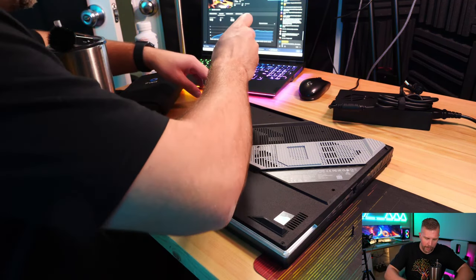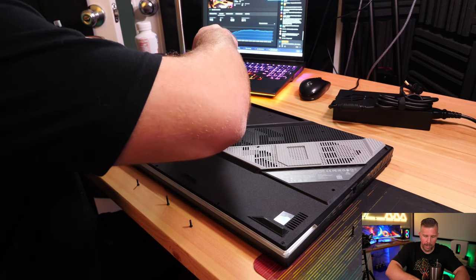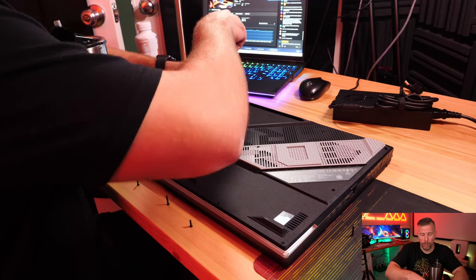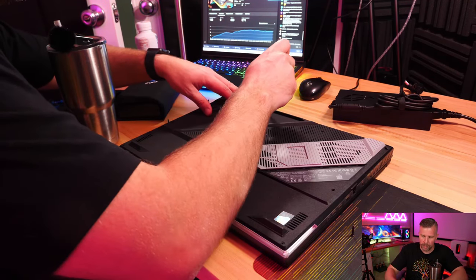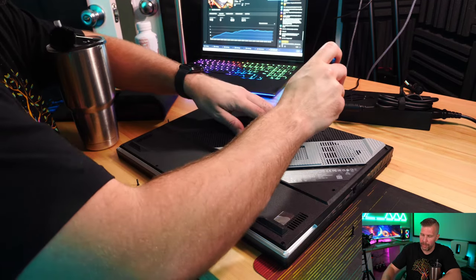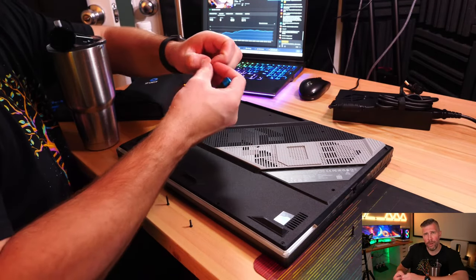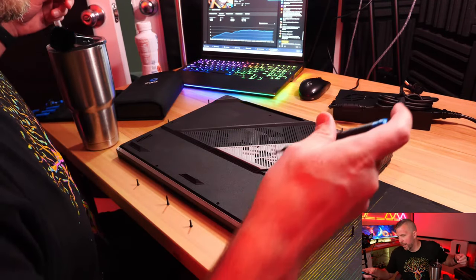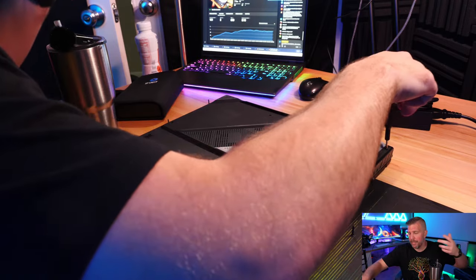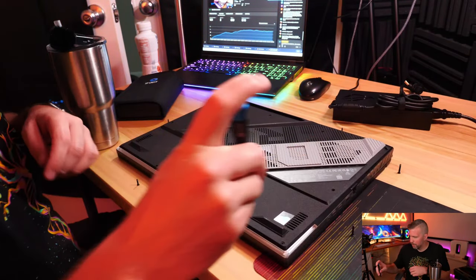I know that some people are obsessed with having almost no fan noise. I mean, generally, probably don't get a gaming laptop if you want no fan noise. Or if you want no fan noise, just accept that there's going to be less performance in super quiet mode. And in that case, I probably wouldn't recommend the Scar to someone like that. If you're going to run it on zero fan decibel mode at reduced power limits, I'm not sure if the coil... actually, I don't know. Maybe the coil whine is just not as pronounced when it's on lower power voltage. We should test, because that would be interesting. I wouldn't be surprised if at lower voltage it doesn't make the noise, because it's probably only when it's pulling really high wattage that it makes the noise.